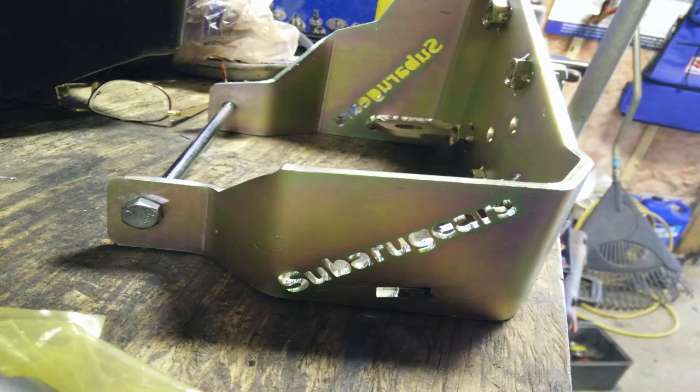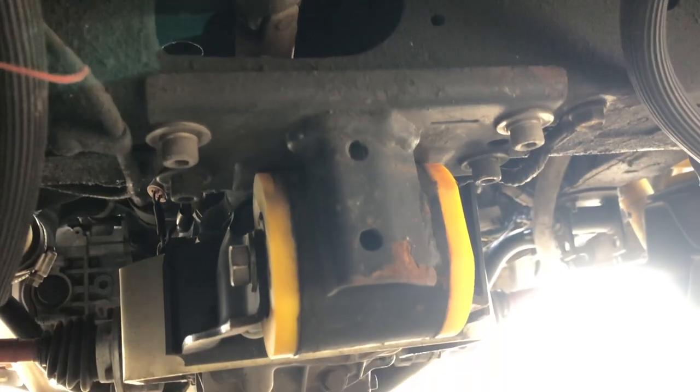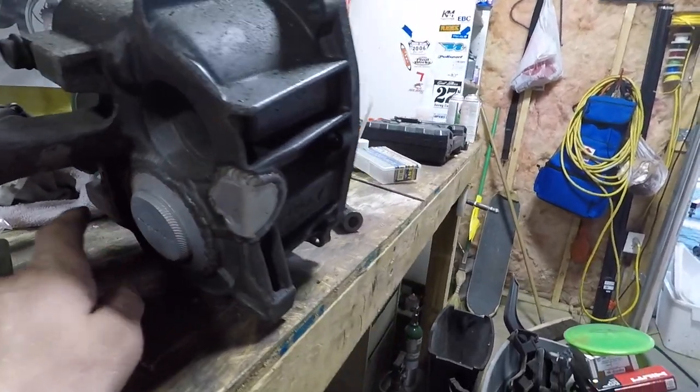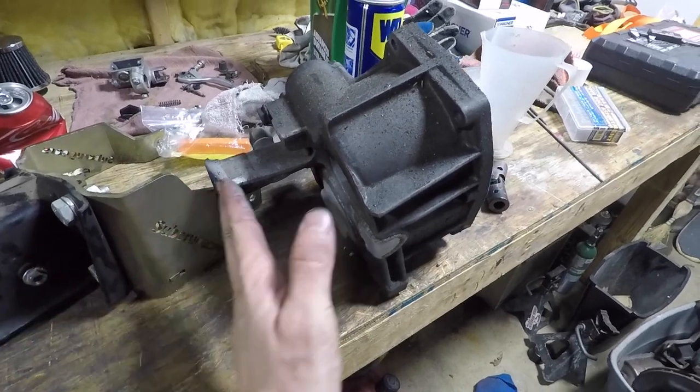I bought the stock clutch for the Subaru and got the stock starter with the transmission. I had to get two shorter axles — which is noted on Subaru Gear's website — for each side, because the Subaru transmission is wider and the axles need to be shorter. So I had to get two new axles. I also had to buy the mount on the front of the transmission that allows you to bolt the Subaru transmission to the van's body. I got that off Subaru Gears, and I cut my nose cone piece myself and welded it. There are a couple of holes you have to plug and weld in order to seal up that transmission, because there's a center diff in there that originally goes to the rear wheels on the Subaru car.